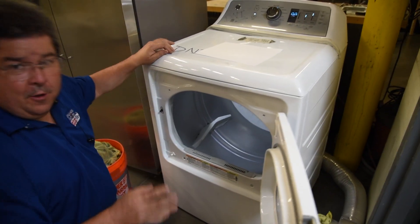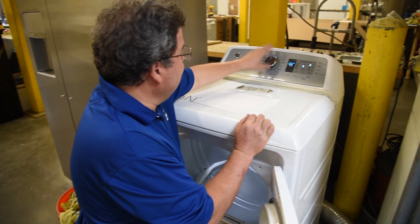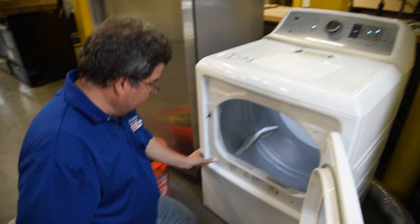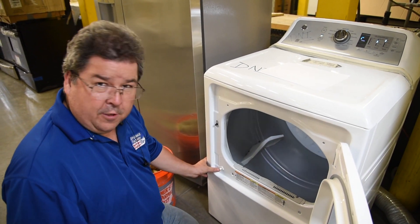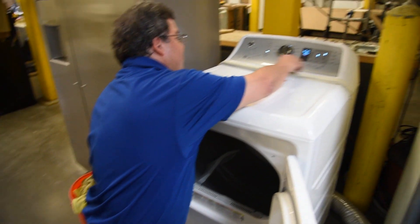You can do this at home and you want to do this at home. What you want to do is set your time on your dryer. Now there's a button that tells the dryer the door is closed — you're going to have to hold that. You can see there's a light, so now it thinks my door is closed. I want to hit start.